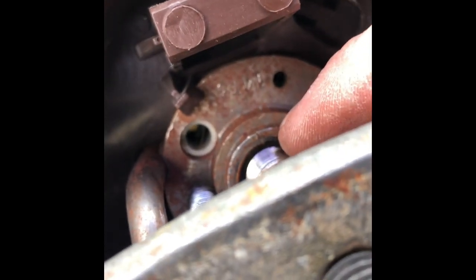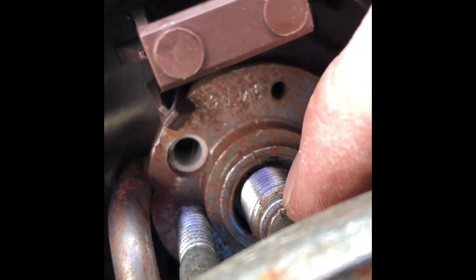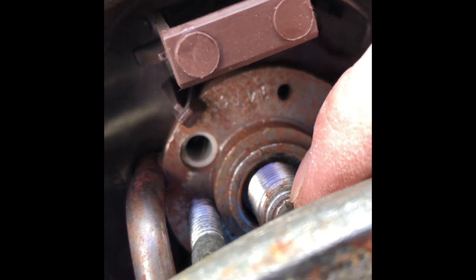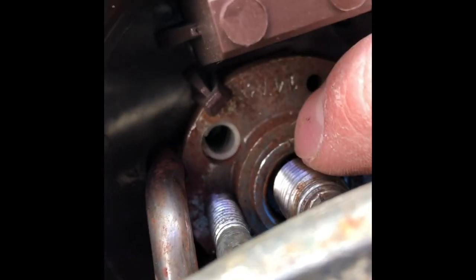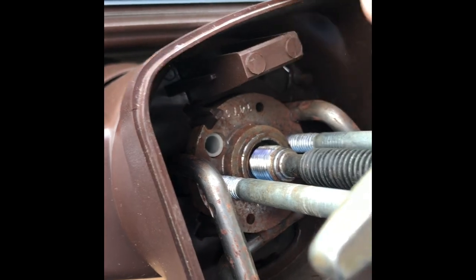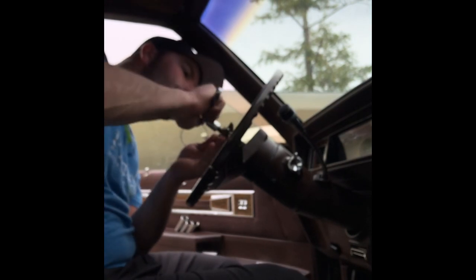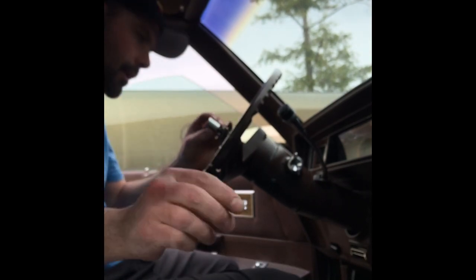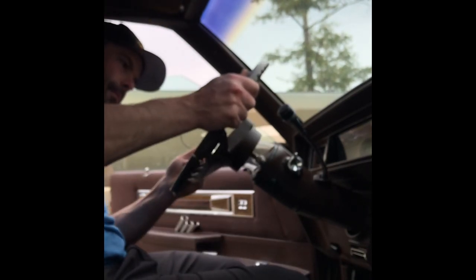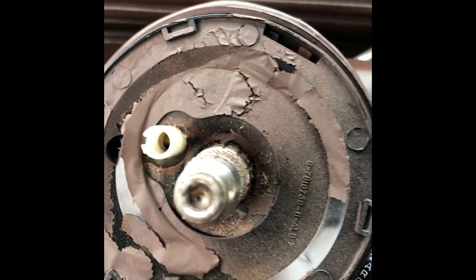If you're worried about knowing where your steering wheel goes, there's a tiny little mark inscribed in the flange on the bolt, and in the top there's a tiny little line, and on the wheel there's a tiny little line too. You might not see it — I've got to clean it up — but I only have this much pulling room, which is pretty sure all I need for these G-body steering wheels. Real easy, two turns going by hand now. There she is — just got the steering wheel pulled off.